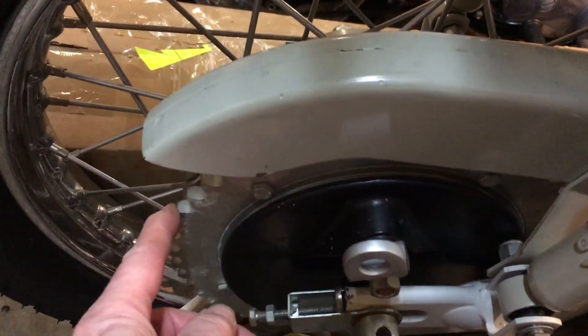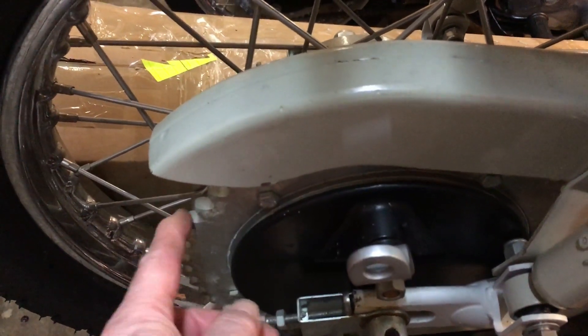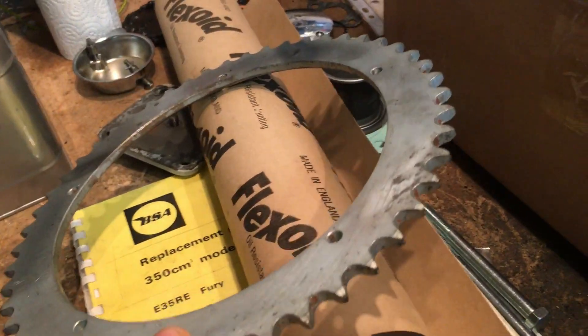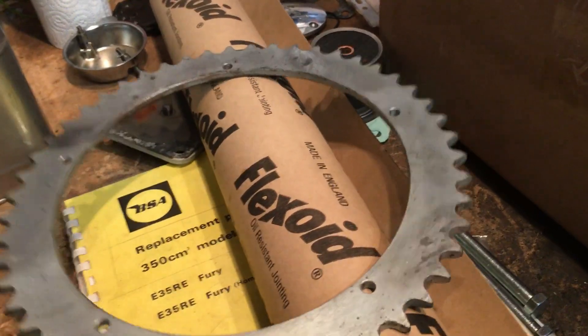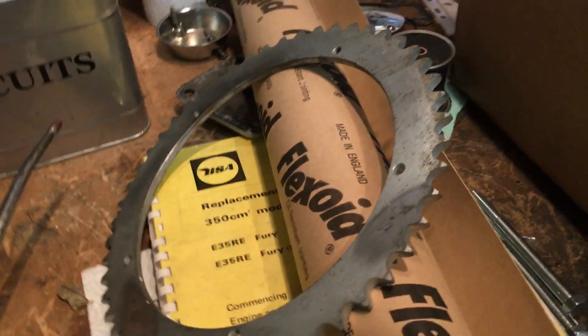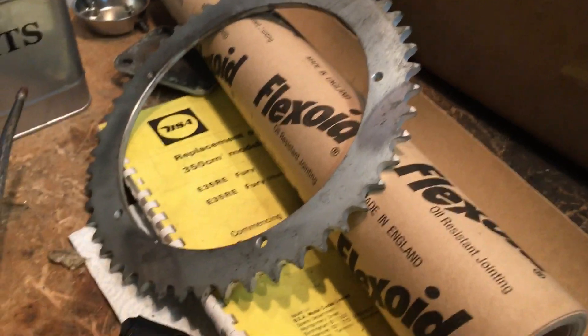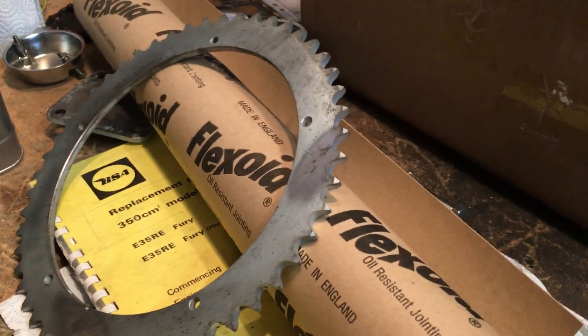On the rear end we've got the correct chain wheel to fit, because the one on there is correct for a larger chain so it's off one of the bigger twins. We've got a thinner one for a smaller pitch chain - we've been cleaning that one up that was in stock and there were a few aberrations on it, but it's cleaned up pretty well. Most of the original zinc plating has held up quite well - one side is slightly better than the other, so that'll determine which way around we put it on, with the good side on the outer side.